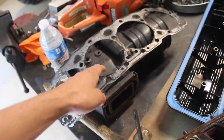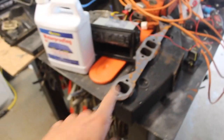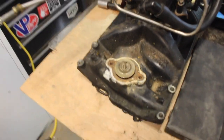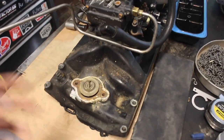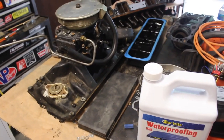This is a Volvo Penta specific unit. And here's the actual headers. The exhaust manifold, you can see some rust and water in there, so I'll have to clean all that up. And then while I'm at it, I'm going to change the thermostat and the temperature sending unit. They're cheap, and then I still got to pull the other head off, clean up everything, and put it back together. So a little slow, but yeah, we'll get there.